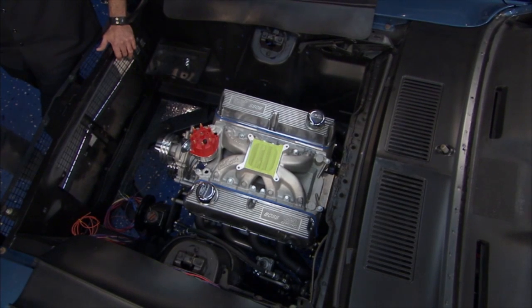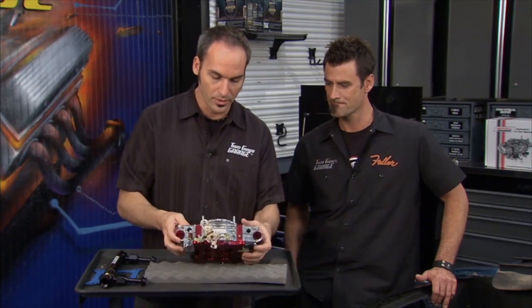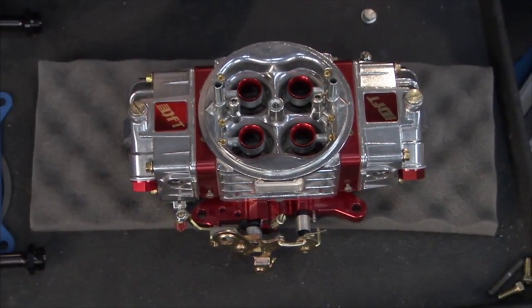It's all about matching — getting the right sizes for everything. For 500 horsepower, we're just squeezing by that 650 CFM and bumping into the 750 CFM range. So we've got a really cool carburetor from Quick Fuel Technologies. It's pretty much a full-on race setup, and we set it up for racing but baked in a few drivability features.